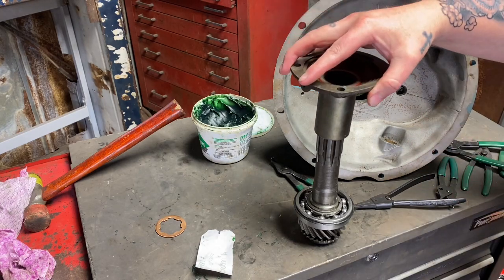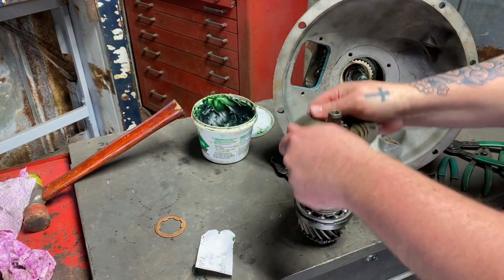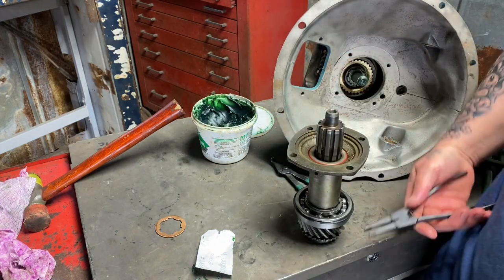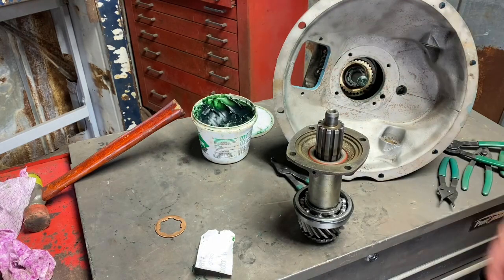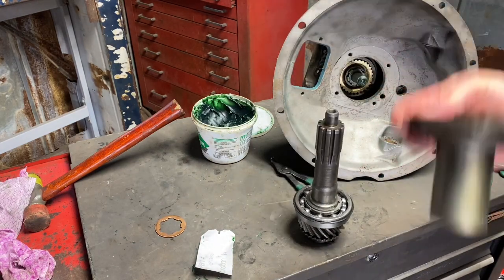that's not my trick, that I've seen some of the older guys do, which I'm probably going to start doing now, is you take this, put it upside down, and when you open the ring, you push down really hard with this, and you can open this up with your hip, get a little bit more leverage to get it further open, and it doesn't buckle on you because you're pushing down with this, and it literally just went in like butter, like super easy. So I don't know why I didn't think about that a minute ago.